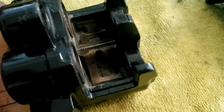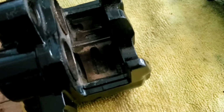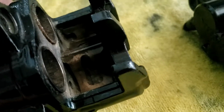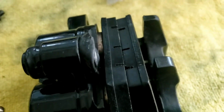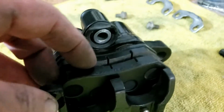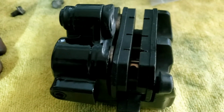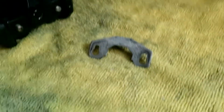Yes. So because there's shims inboard on these, which is kind of unusual, at least as far as I'm concerned, what we've done so far is just slot one of these pins through on this side. You can see it just protruding there, and then we're going to have to hold the pads down on the shims while we slot this one through. So now we've got both pins through, pads are nicely located and sprung in place, and we're ready to put our slightly cleaned up tab on top.